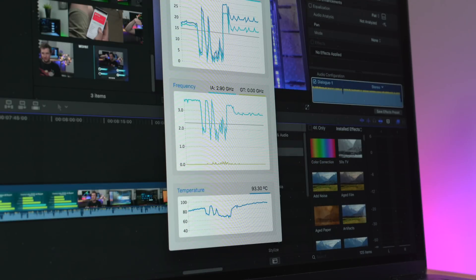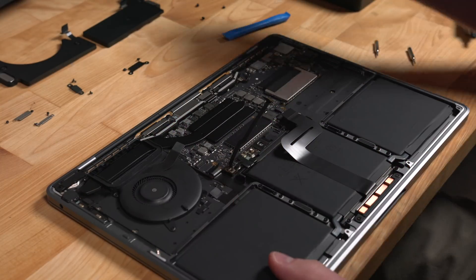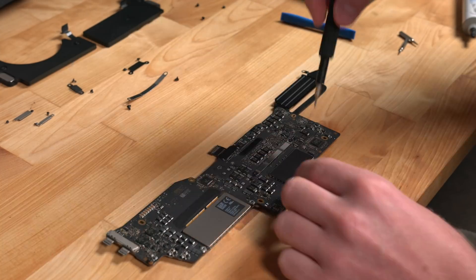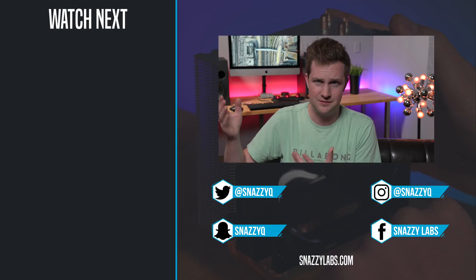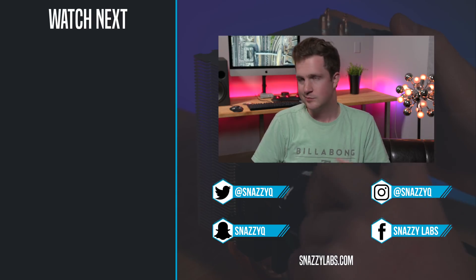Now the machine still hits 100 degrees Celsius and it still does thermal throttle, but it doesn't decrease the clock speed as severely. Taking apart your MacBook Pro is not for the faint of heart. There are several very delicate ribbon connectors that you can damage pretty easily, an obscene amount of differently sized screws you need to keep track of, and an annoyingly tight CPU retention bracket. Yes, there is better performance and yes, it is measurable. But is a mere 9% improvement in tasks like video editing worth the time and risk of doing the modification yourself? Probably not.